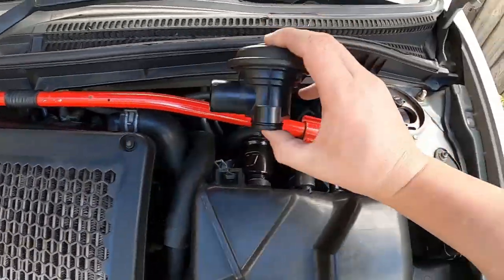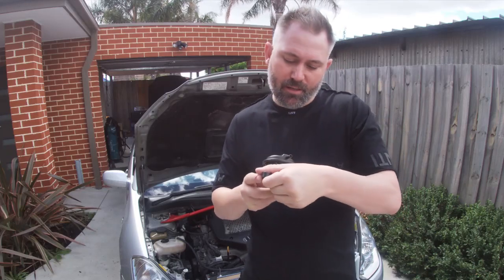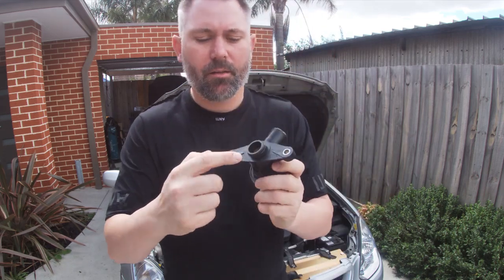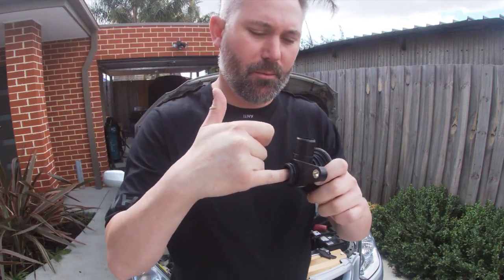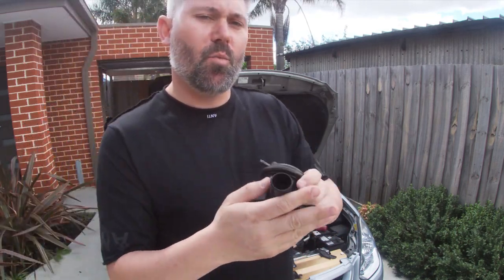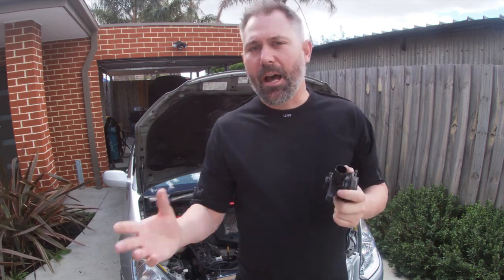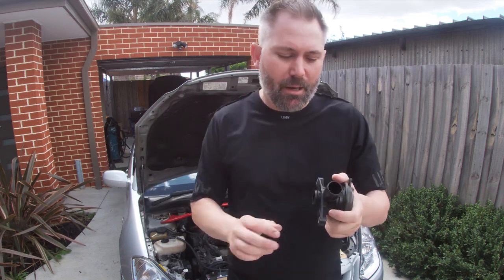For some reason, Toyota have done it a little bit backwards. This is the factory Toyota blow-off valve — it's the Denso, made in Japan, factory plastic blow-off valve. You'll see just in here, that's the piston there that pushes up and down. It's actually so light with little to no force that you can move that piston, which is one reason why you need to replace a factory blow-off valve. Yes, they work and they do their job. But essentially, changing a blow-off valve is going to change the power delivery and how the power feels and how it comes on. So it's a really worthwhile mod to get back some free power that you'll be losing, and I'll explain why right now.